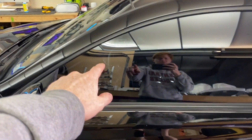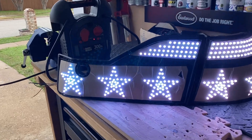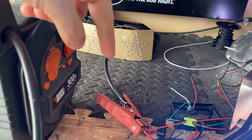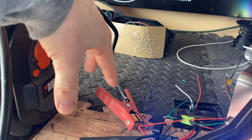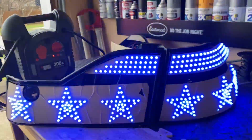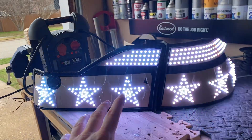Instead of the small power supply, I was using the Ginny as my power supply off the battery, but then I remembered I have a jump box, so I got that hooked up and it's working a lot better. Another tip from Stop Motion was to have the power go directly to the lights themselves instead of routing through the Blue Ghost module first. These run on five volts, so I can't run straight 12 volts into the LEDs — we're using a 12-volt to 5-volt converter pushing 15 amps. I thought it was smart to install the converter inside the taillights, one converter per side, so we won't run low on amperage.